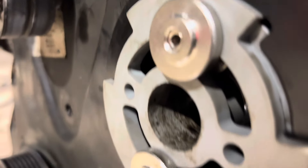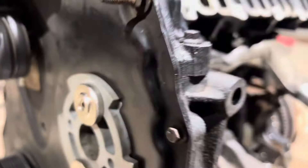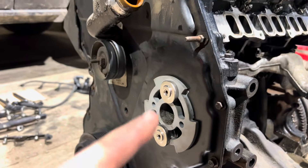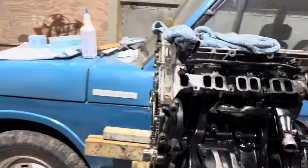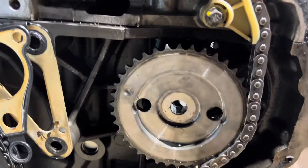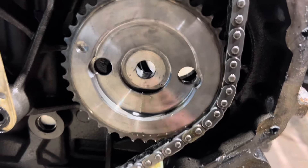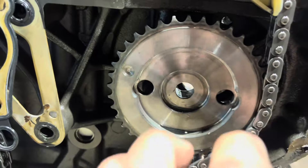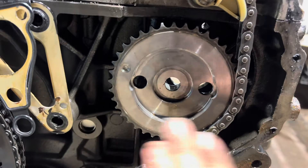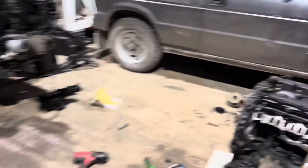Wind these as far as you can. Be careful — you don't want to wind them so the collar drops off on the other side. The threads are now wedged in, and I can show you over here on this engine: those threads are now wedged in here. They don't wind into anything — on the ones I've done they don't — so they just wedge up against the sides and they lock that in place, holding the tension from the chain moving in.